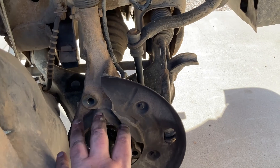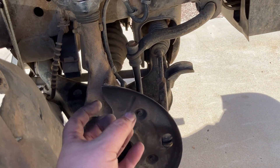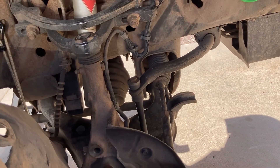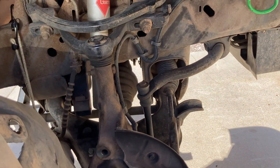It's this gray line that comes up — this line comes from the engine and goes into the bottle here. Then this line comes out as a thicker line that split between the four-wheel drive system. This black line comes up and over and it's drooped down into this system. The gray line comes out and it controls the solenoid for the hot water — for the heater. My heat works just fine, so that's not a problem. We're going to get the lines zip-tied up into place, put the fender liner back, and then get to work on these ball joints.